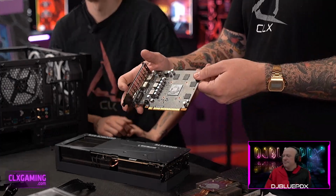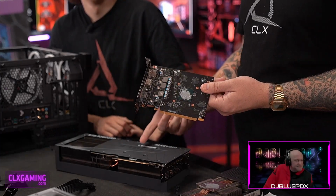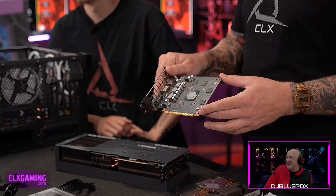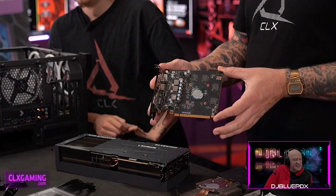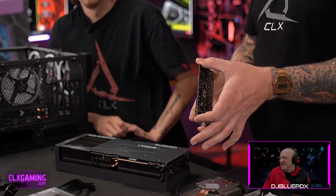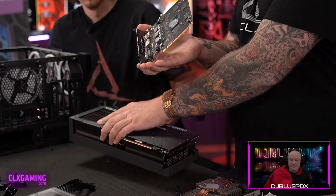This is our GPU here. So this spot where you see thermal paste and those 4 screw holes, that's what I was talking about on the back of this. So this is all your GPU is, this thin card right here. It's got your GPU there and your memory chips around it. But this is always just really cool to me to show how thin your video card actually is. And all this giant part of this card is just to deal with the heat that it generates.